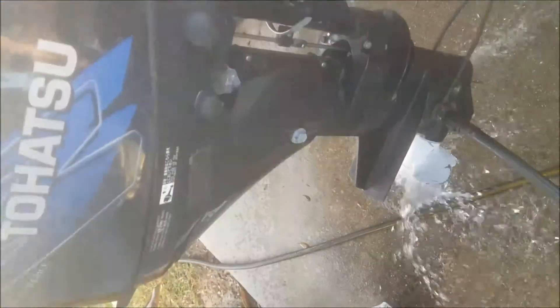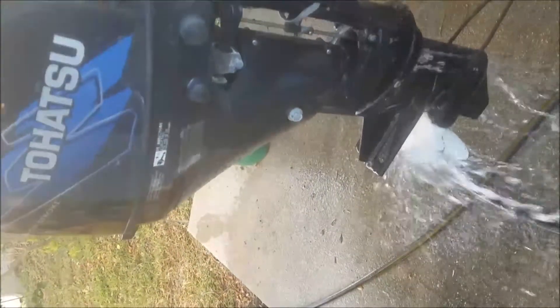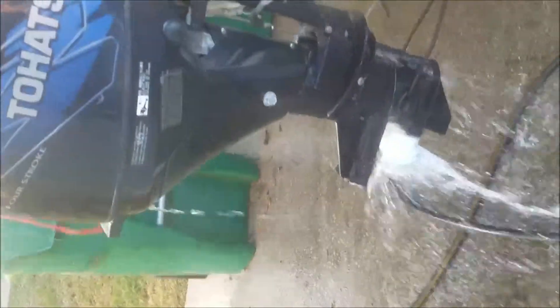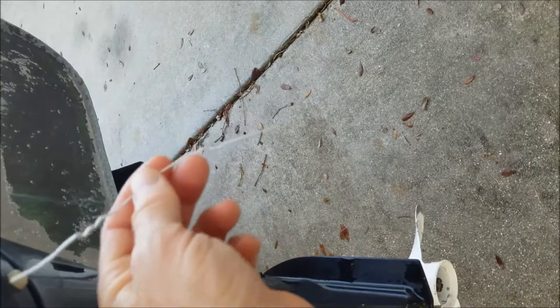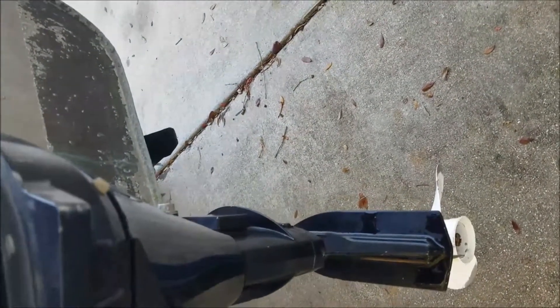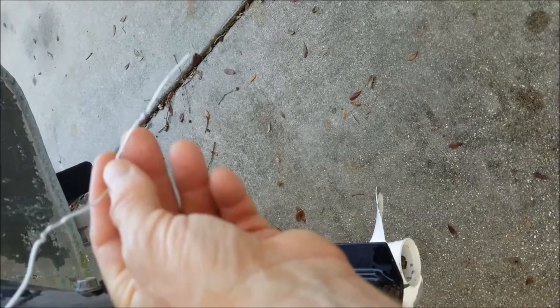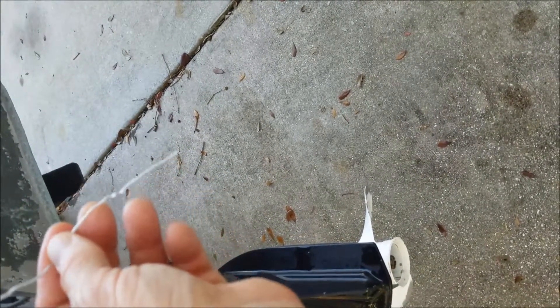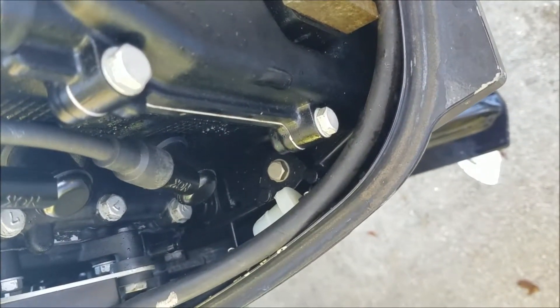I started it up to see if we have water going through the motor, but I didn't get a very good water flow coming out, so I'm going to check for any blockage in the hose. I already removed it and I'm sticking a wire up into the hose — I don't feel any blockage yet. Since there are so many bends I don't want to make a hole in the hose, so I'm going to blow into it to see if there's any blockage and if so take the hose off and try to clear it out.